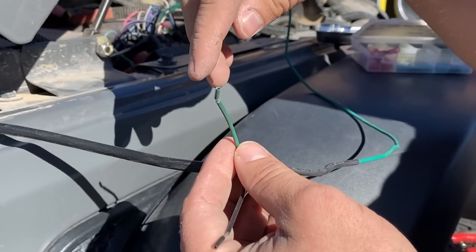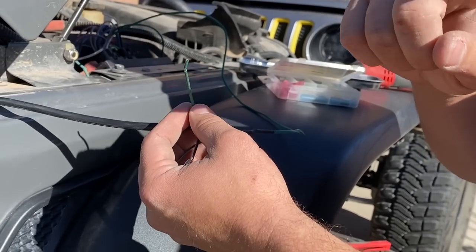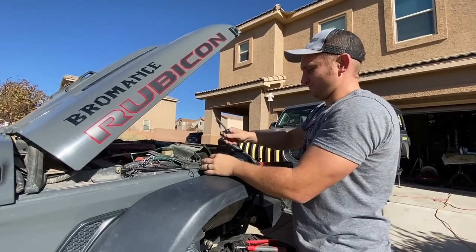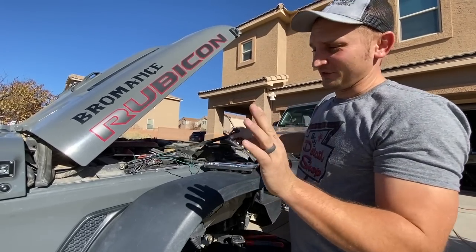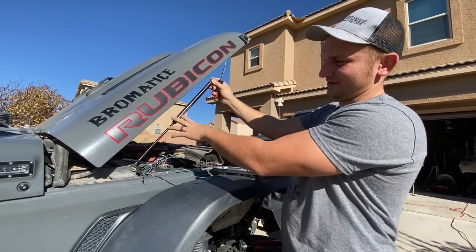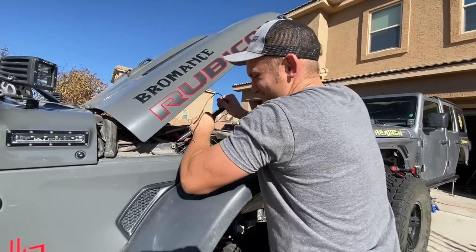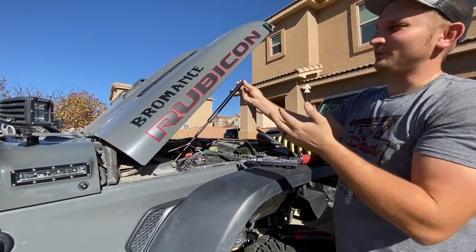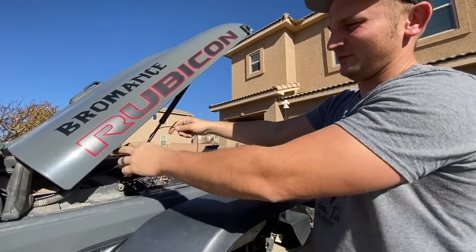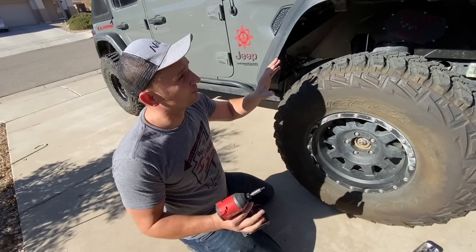The turn signal is not required obviously, but if you want it to work with your turn signals you're going to have to splice into the turn signal line — it's the same on both sides. In my excitement I kind of wired it on the outside of my hood strut. Just make sure you're running it where it needs to go before you commit to soldering, otherwise you're going to have to clip your lines and redo it.